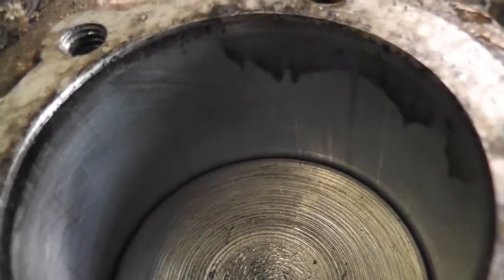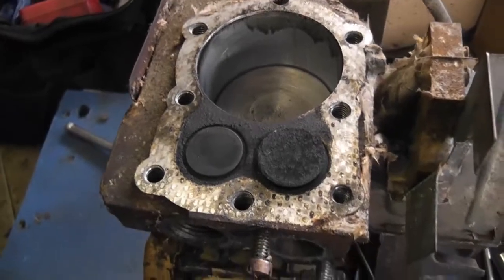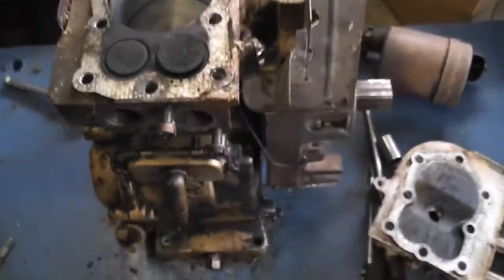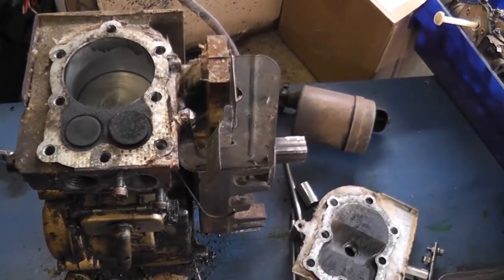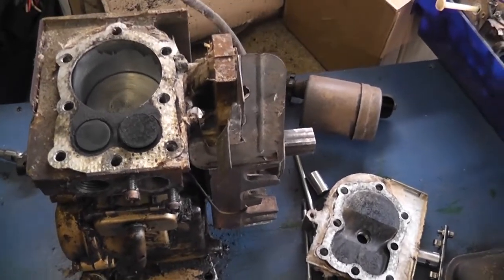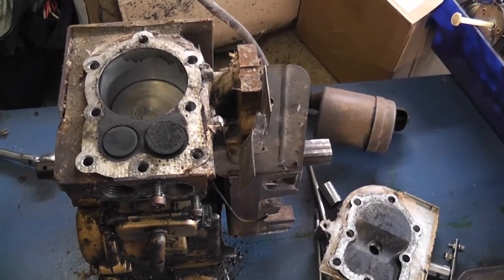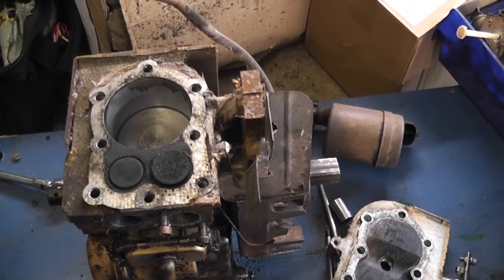You can actually still see the honing marks inside - the swirl marks. That's brilliant, I'm very happy with that. That definitely bodes well for this restoration and I'm certainly not going to go honing that cylinder. That's obviously not been the cause of our smokiness. I'd say the smokiness is caused by the carburetor needing adjustment. I'm not even sure if it was burning oil to be honest.